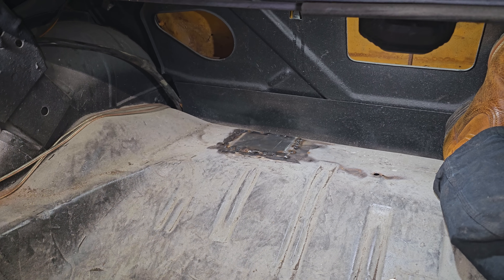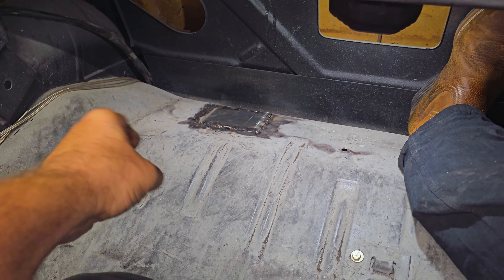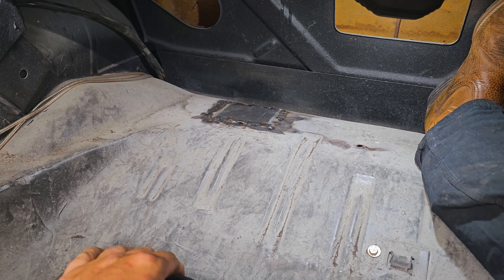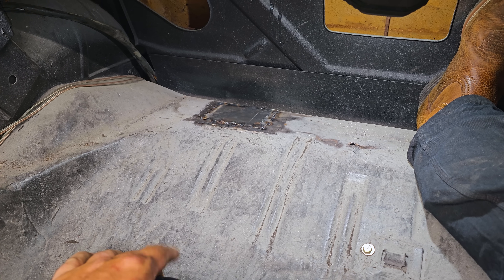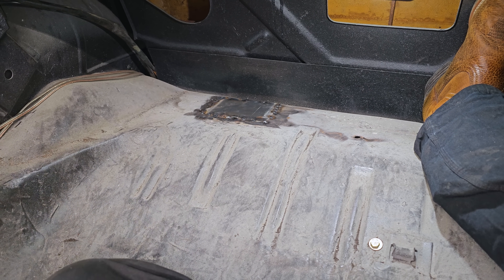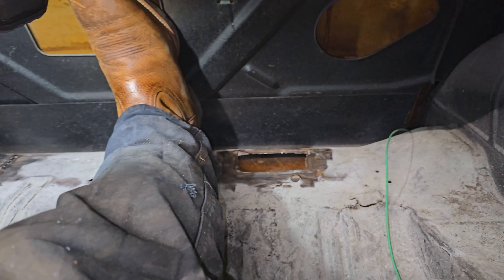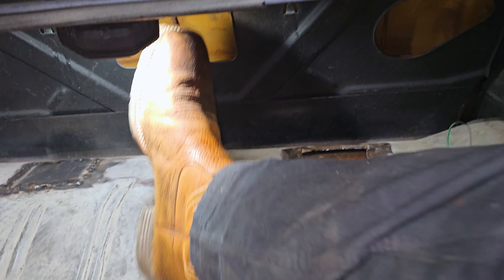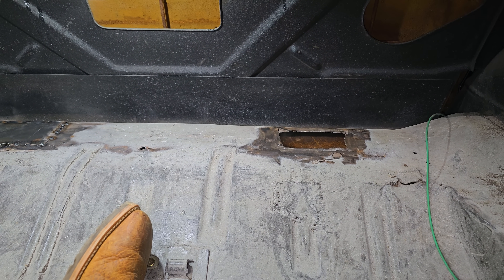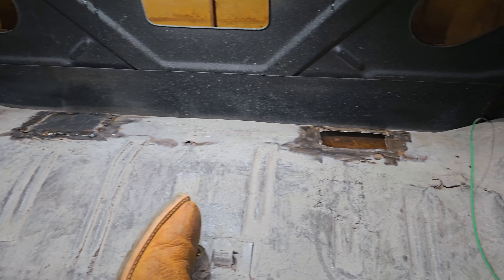Well, that's all tacked in. Not the prettiest thing I've done sitting way back here with no helmet, but it's a lot better than a gaping hole. It doesn't really matter because we're going to be seam sealing that in here in a bit — pretty much factory floors, that's all I did was stitch weld it. On to the next one — basically same thing, rinse and repeat. Let them cool down a little bit, then clean up and get that seam seal on.